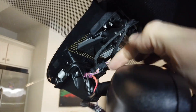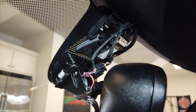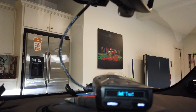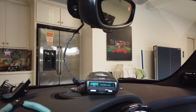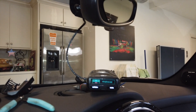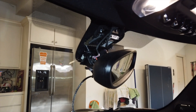I've got my piggyback jumpers in there — they slid in pretty easily with the plug unplugged. Before putting everything back together, we'll plug the radar detector in to test it. We're getting power. The engine isn't on, and when you turn the ignition off it will stay on briefly but all the power will eventually go down. We at least have power, so we'll plug everything back in and retest before putting the cover on.